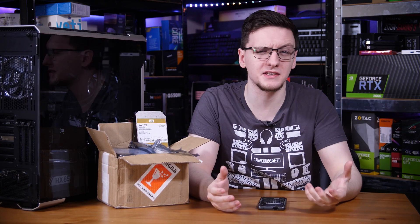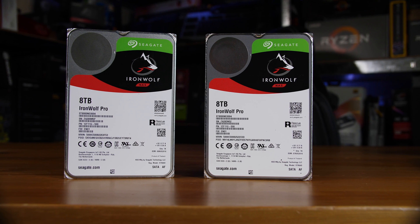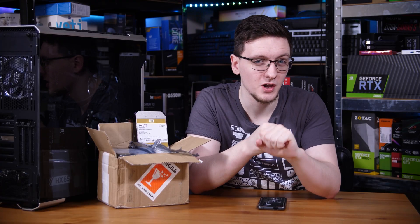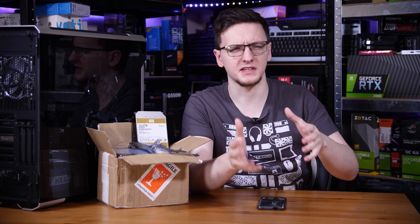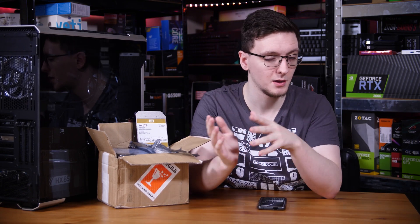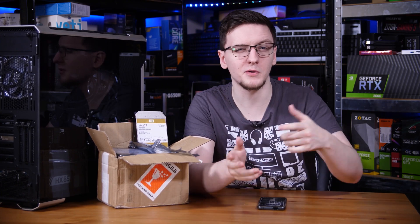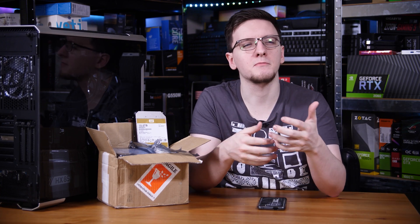My current primary NAS is an old QNAP that I reviewed a long while ago and has four 8-terabyte drives. Two of them are Seagate IronWolf Pros which is good, but the other two are a Toshiba N300 and a Seagate Archive drive — an SMR shingled magnetic recording drive — and they're all running in essentially RAID 5. So I do have some redundancy; if one drive fails I can rebuild the array and in theory not lose data, although in practice rebuilding RAID arrays can cause other drives to fail, so I'm walking on thin ice.